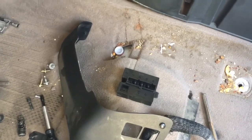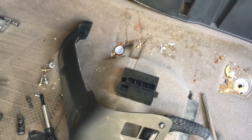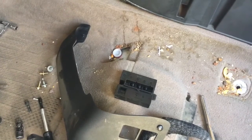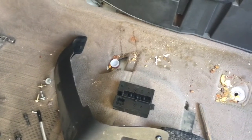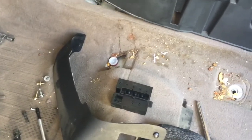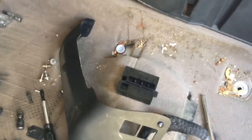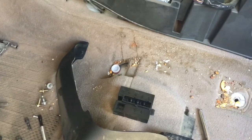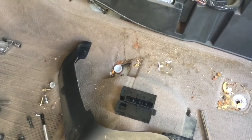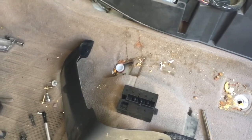Now, a lot of people had issues with hub actuators from water getting down in there and then filling the bladders that control those actuators. Now, on this truck, I haven't had any problems with that that I could isolate. Maybe once doing this, something will be exposed. But anyways, the interesting thing about that to me was there could be a potential of water getting into that solenoid and then getting back into this system here.